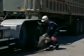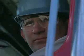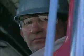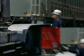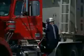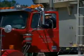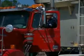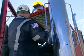After you install the chocks, ask the operator to release all brakes, place the transmission in neutral, and see if the truck moves. Now ask the operator to turn off the truck. Climb the steps to the cab area, introduce yourself, and ask if a pre-operational check of the vehicle was done prior to being operated. Ask to see the operator's training records.